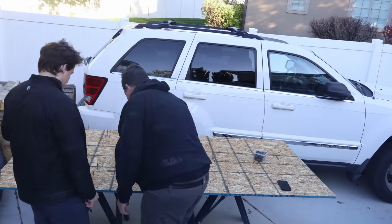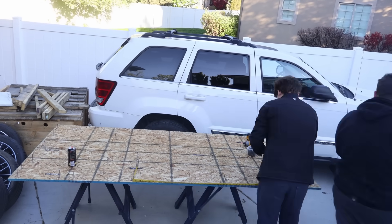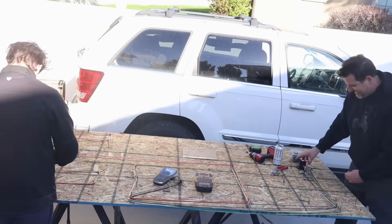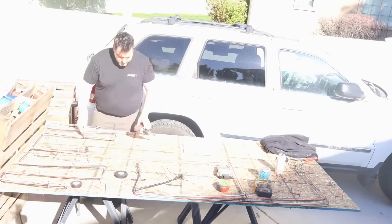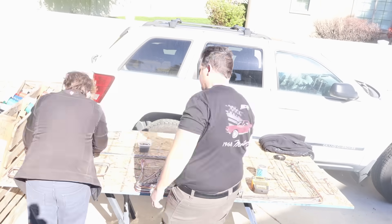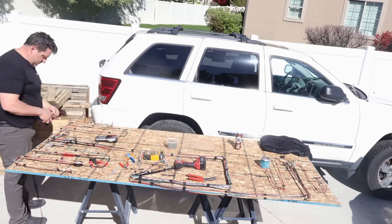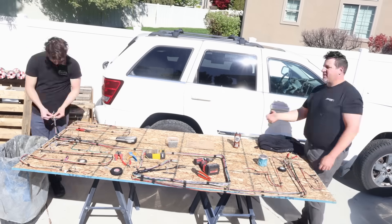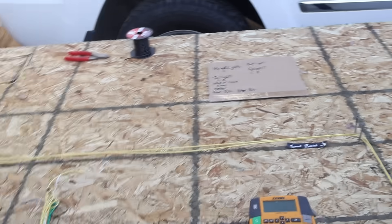All of these wires are important. They are different size gauges — smaller gauges for smaller consumers and bigger gauges for bigger consumers. Right over here we have our headlights stuff, and I believe this is seven feet away from our PDM. So if you measured all this length right out here, that would be seven feet to the PDM. We are using a hardwire PDM and that will do all the controlling.